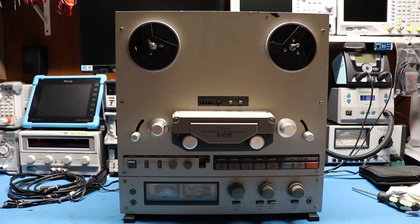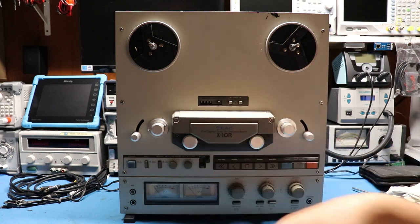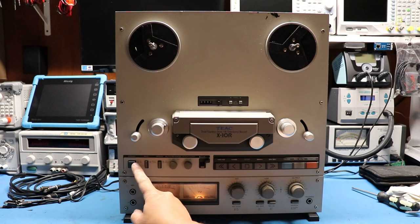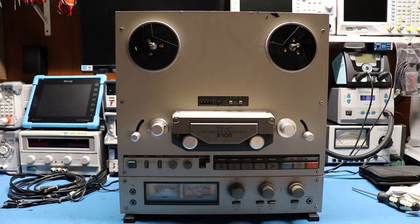I'm gonna have to remove all that and clean it up including off the transport - it's gonna be a complete mess. I'm going to take this completely out, tear it all the way apart, do a rebuild on that transport, put new belts on it, and hope it works. Normally these need basic service, sometimes you have to go through caps and all that, but most of the time these are actually pretty reliable. But first I've got to get this part at least rebuilt before anything just to see if it'll actually work - I know it turns on but it's stuck so I've got to fix that first.